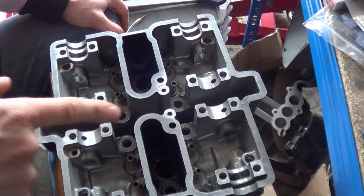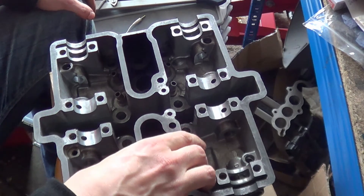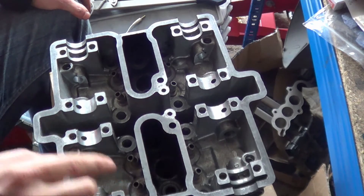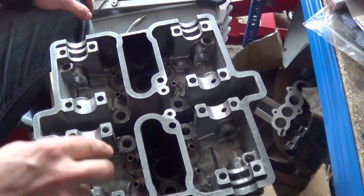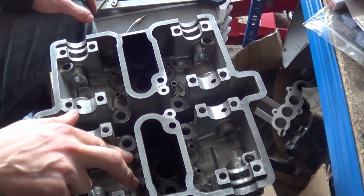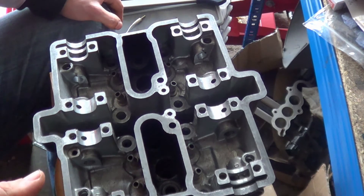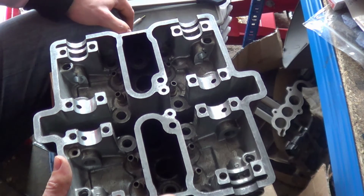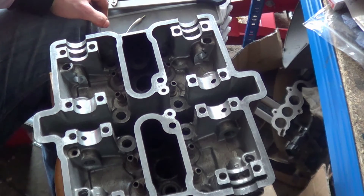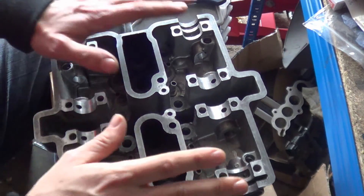For each of these valves at the bottom there is a valve spring seat — don't forget them. They also have clip-on umbrella seals for oil seals, which we'll get to. Make sure when you do your lapping that you get absolutely no compound inside the valve guides, because it will ruin them in seconds when you first start the engine. Apart from that, it's all pretty standard — valve seats, retainers, collets, and so on.